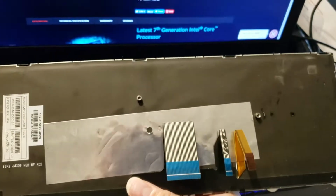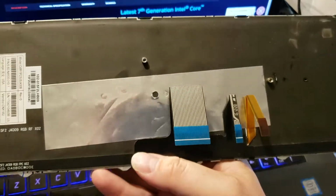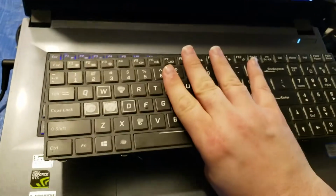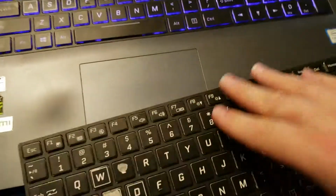Anyway, you've got 2 screws that hold it to the laptop. You're going to remove those screws. For the centermost screw, you're going to use a tool or a paper clip to push through until it pops the keyboard free at the top. So at the top here and on the sides, you have these plastic retaining clips. They go all the way around the rim.